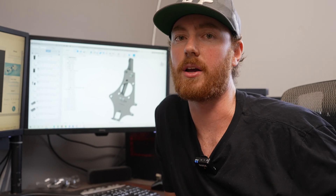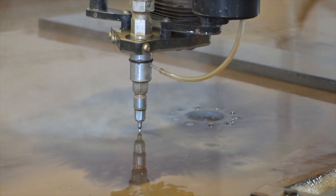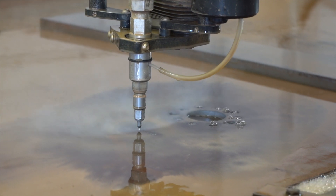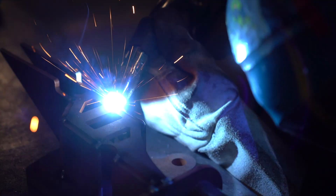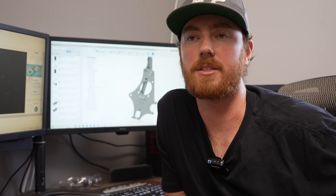Not understanding how these things work on a chassis, it's really easy to make these mistakes, so this is going to give you guys some really good first-hand insight on what works, what doesn't, and how to do it — not that you're going to be doing it yourself, but you'll definitely know what goes into it and why our products work the way they do. The last step is to create DXF files and solid models of these parts so we can send them to our waterjet and CNC machine to cut them from a plate of alloy steel, and then the welding department can weld on the threaded adapters, uniball cups, and whatever else they need.